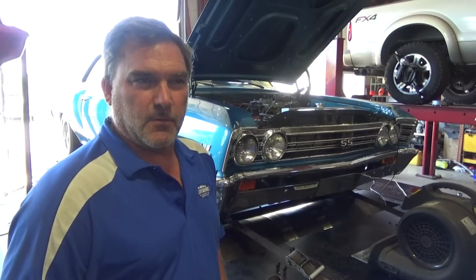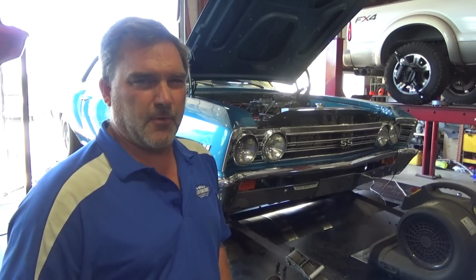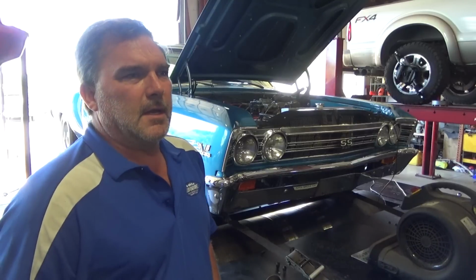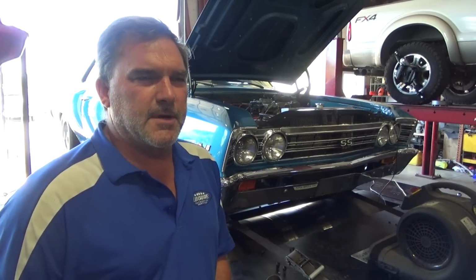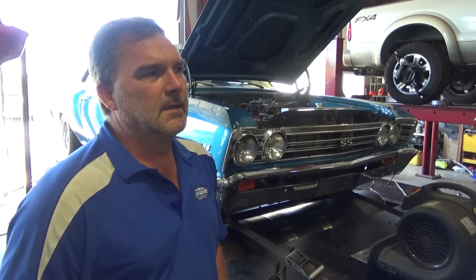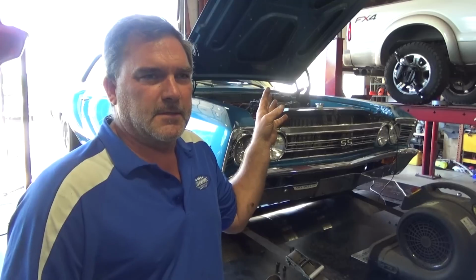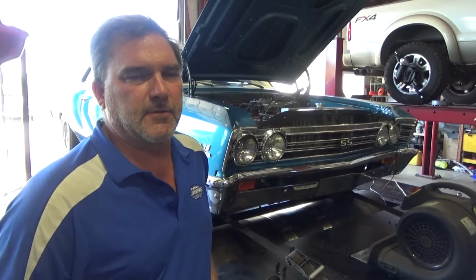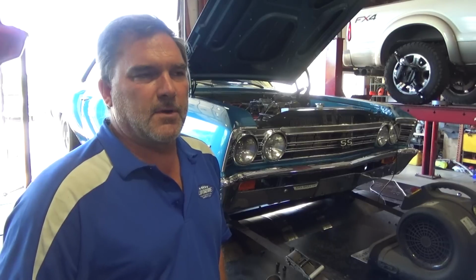I found the power valve looked wet, so I put in a new power valve, same, it was a 3.5, which I feel is low. And I'm not familiar with power valves on vacuum secondaries because it was my understanding they're just supposed to be dumpers, but a power valve would add a little extra really. But I ended up putting a spring in the back to hopefully eliminate the secondaries from opening up. I just want to tune the front side of the carb right now.